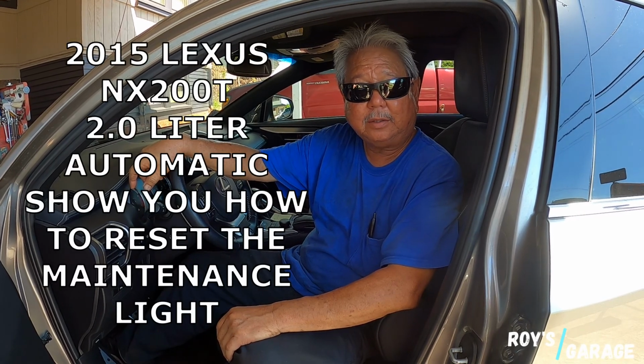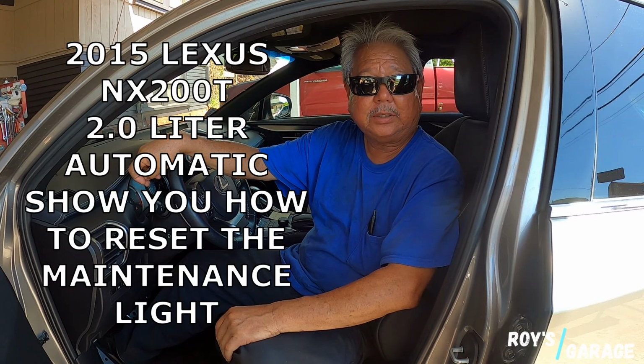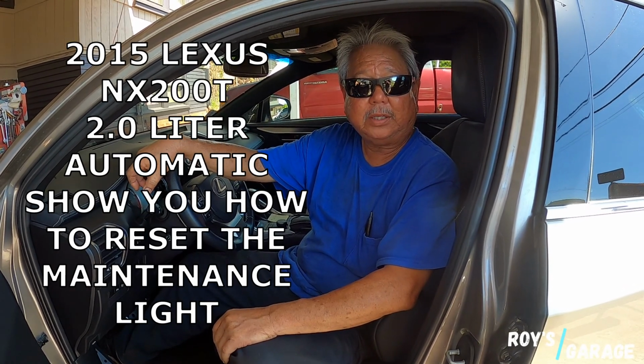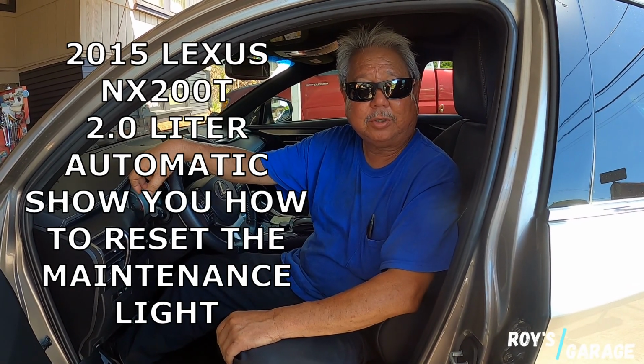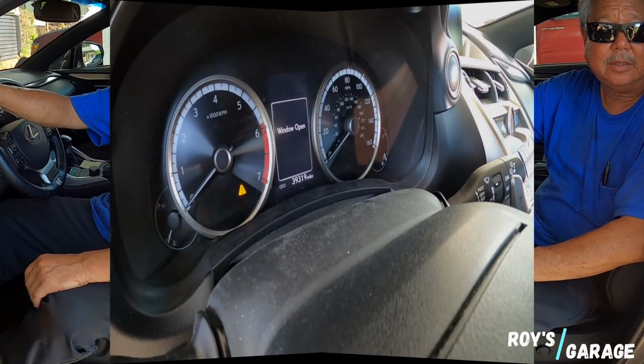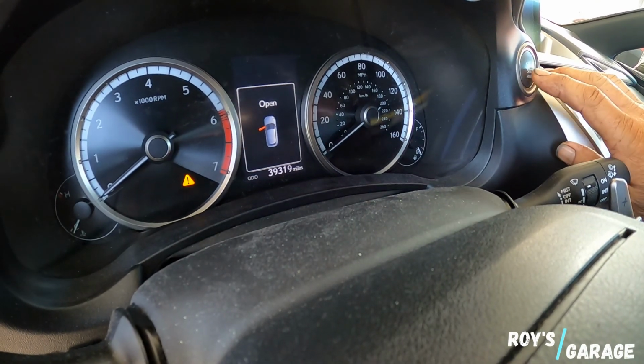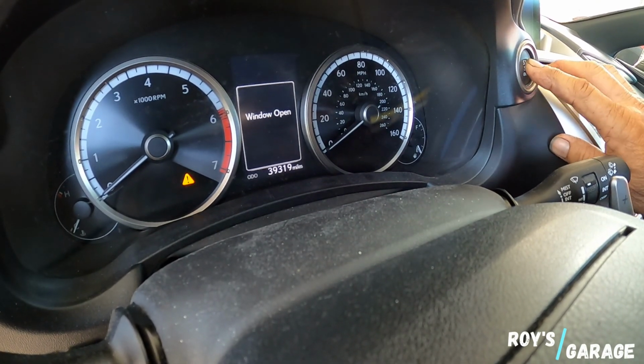Today I'm going to be working on a 2015 Lexus NX200T 2.0 liter automatic. I'm going to show you how to reset the maintenance light. Okay, first we're going to be hitting the starter button 2 times.